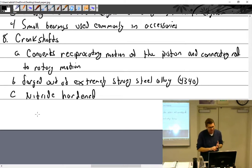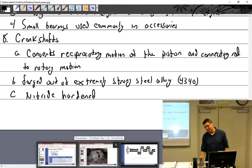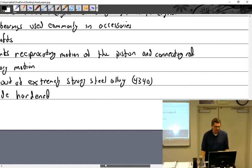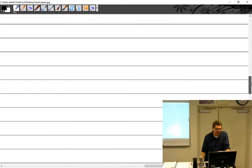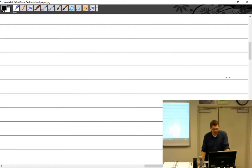They changed the requirements — now they want you to re-nitride at three, six, and ten, because the nitriding isn't thick enough. I would often get a crankshaft, do my in-house NDT, determine I wanted it at six-under, send it out for grinding and re-nitriding, and get a phone call: 'Hey, we lost it in nitriding,' meaning it sagged or cracked because of the heat during the process.